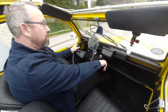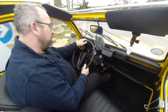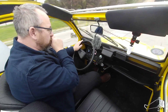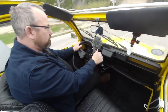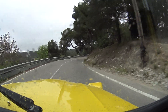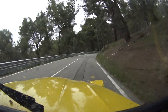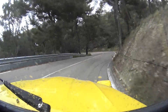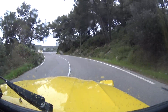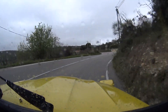And it's now starting to rain — would you believe it, in the south of France! Now, as I mentioned, this car uses the same electrics as the Eden. It's got a four-speed 2CV gearbox but with an electric motor attached to it. As you can see, we're on quite a steep hill in the south of France and I'm in third gear, hardly touching the accelerator, and it's pulling up very easily. You do not need first — first is way too low for the electric motor. It's essentially a fourth-gear car; only on an extremely steep hill would you drop to second.